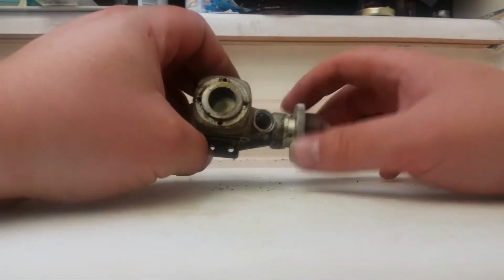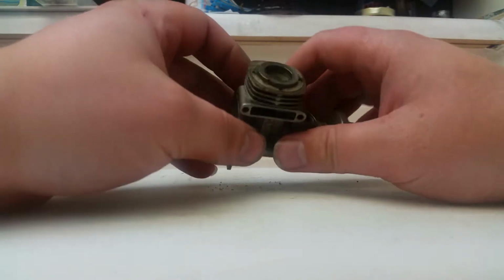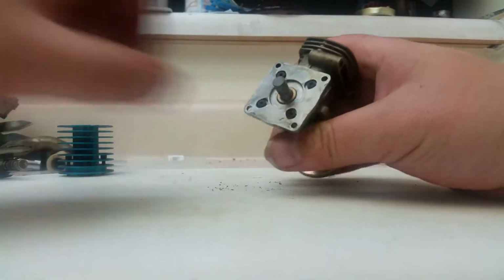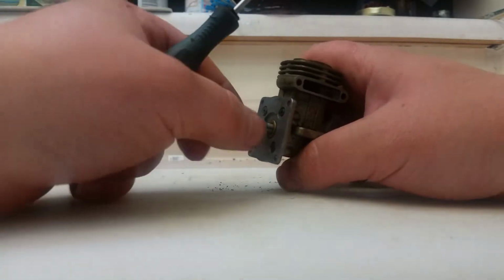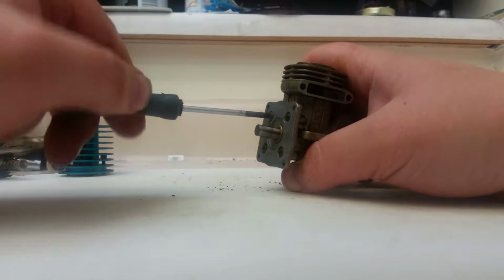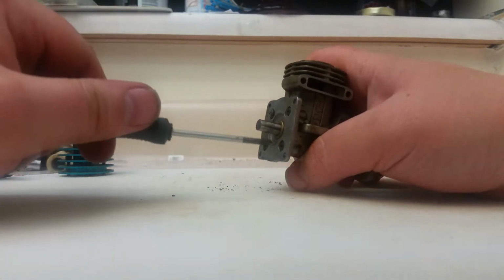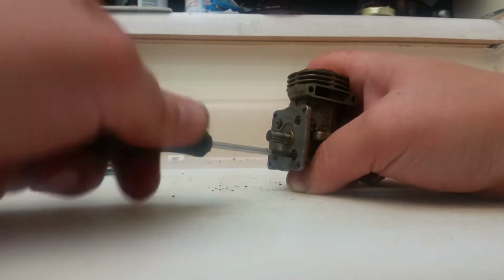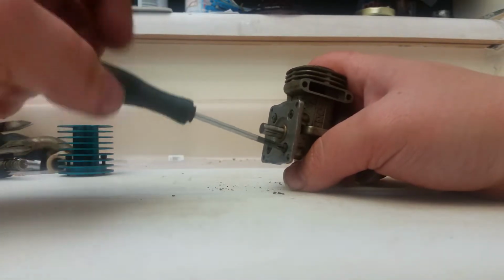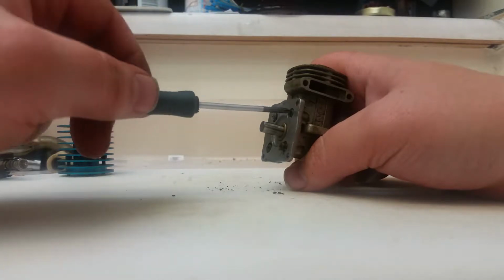Okay, let's have a look. We can see our piston there. Doesn't feel like there's much pinch left. And we got Phillips in the back. Let's remove those. Starter shaft feels okay. Hopefully these come out without too much fuss. Oh, okay, good. I hate Phillips screws. Unless you got the JIS, I think, what is it, JSP screwdrivers and all that other fun stuff.